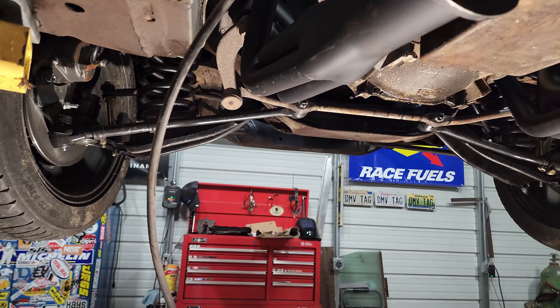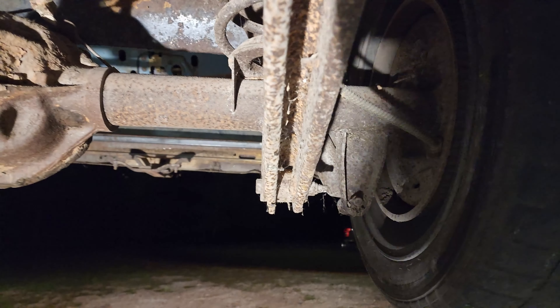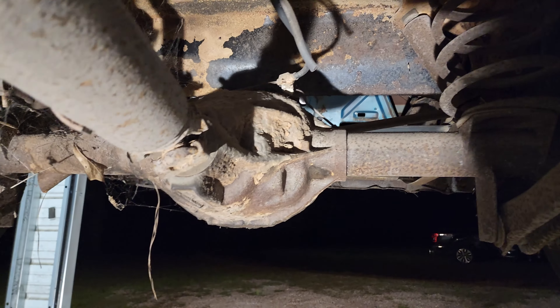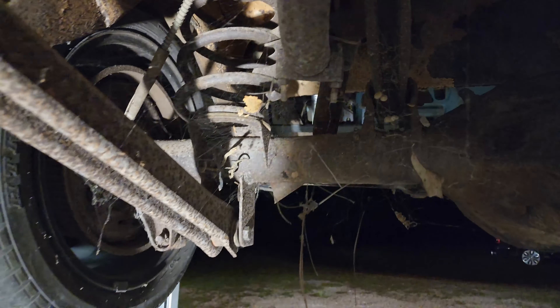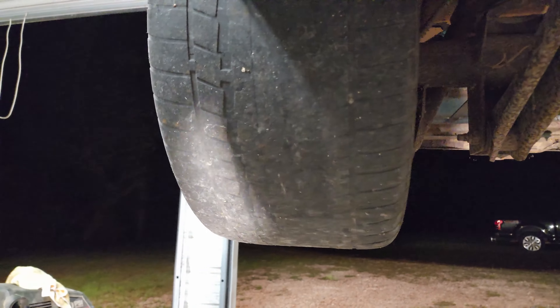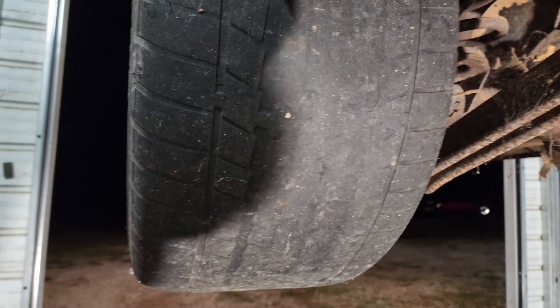There's parts sitting in the floor right there — not a big deal, but we're going to clean up this frame and the underside, get it nice and painted. This is the 8-inch rear out back. I'll eventually swap it for a 9-inch or something that can handle a little bit more power, but for now the 8-inch should work. We're going to check all the seals, brakes, make sure everything's good — change the rubber gaskets and grommets out. It looks like the pinion seal probably had a leak, or the transmission was leaking. The FMX that came out of it was covered in transmission fluid, so I assume it was leaking and blowing back on the rear. We're going to go ahead and do the pinion seal and clean up the rear and get it looking nice.